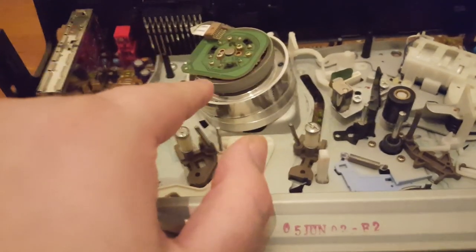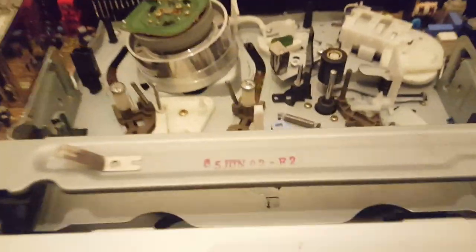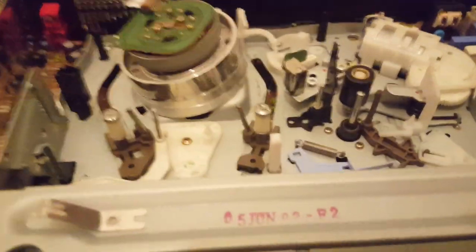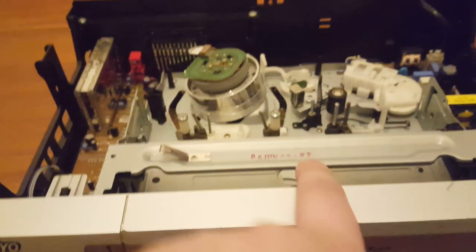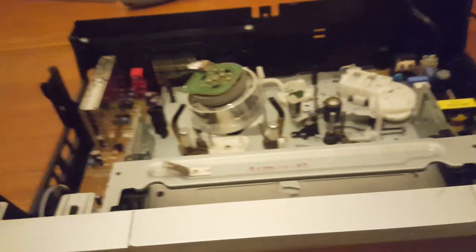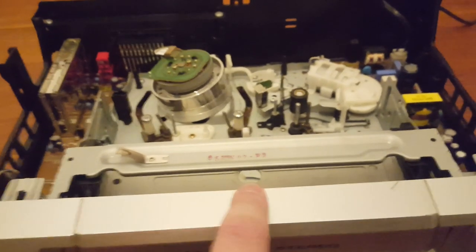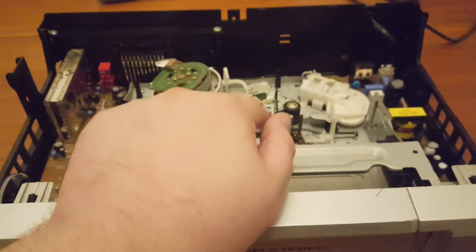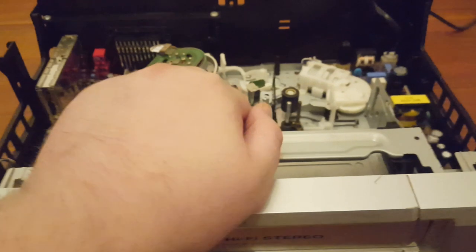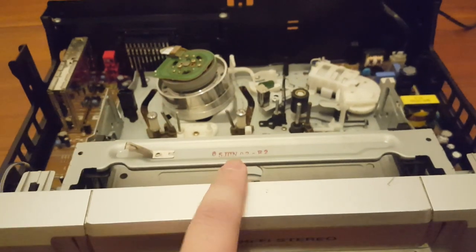Check your heads and make sure they're clear, and check your idler mechanism. Some idlers will have grease on them; after a while this grease gets worn away. If you've got a sticky idler gear, a quick fix most people have in the house is penetrating spray — we call it WD-40 in England. Put some penetrating spray on there and that will enable the gears to move more freely and hopefully fix the problem of tape not getting put back into the cassette.